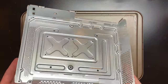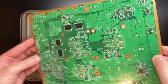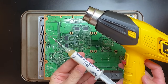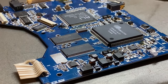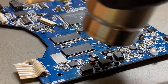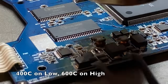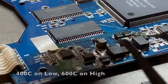I'm just going to use the Xbox metal casing itself to help balance the motherboard and dissipate heat during the reflow. I'm going to be using an inexpensive heat gun with some high quality flux to reflow the GPU. Before I do anything on the Xbox, I'm going to demonstrate what the heat gun will do on a junk board I have lying around. My heat gun has a low and a high setting — the low is rated for 750 degrees and the high is rated for 1100. I'm using it on low throughout this whole process.